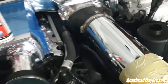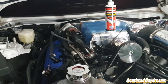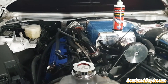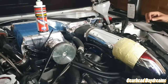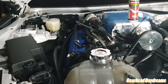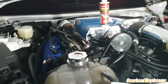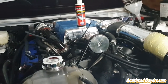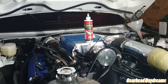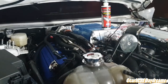We took how much? About 6 liters. Yep. So we went for a 50-50 because it gets quite cold in the UK. So 50-50, 3 liters of coolant, 3 liters of deionized water. So about 5.5. So bear that in mind when you're doing yours, because the instructions aren't very clear. So you should mix up at least 5 liters of the stuff. Yep. And then the rest you can just top up as and when. I ended up buying 10 liters of the coolant and 10 liters of deionized water as well. It doesn't matter, it's the same coolant as my engine, so it's all good.